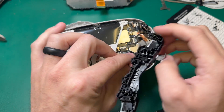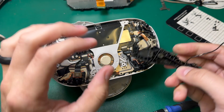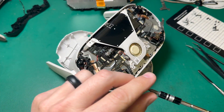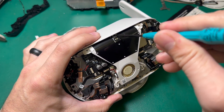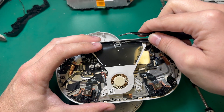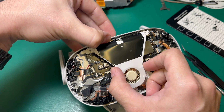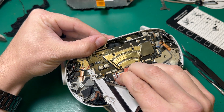Now you can just pull the Bluetooth antenna up. Next thing to go is the fan. We've already taken out one of the screws here and a couple here by removing the Bluetooth antenna. We'll take out that last Phillips triple zero, and there's one more T2 screw that hides above the LED indicator. The LED indicator is adhered on but not very strong — I can usually just pop it off with tweezers. The fan is latched underneath the frame, so I'm going to pull up on the frame and pull down on the fan, then pull directly down on the fan connection.